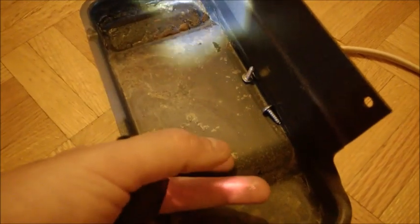Usually you will have this pan here — a catch pan — so all the water from inside the fridge, the condensate, will just leak outside the fridge and evaporate. It usually shouldn't be filled, unless you live in a very humid area. All these pans may have two securing screws. This one has two screws here.